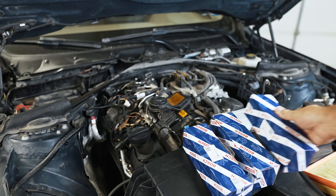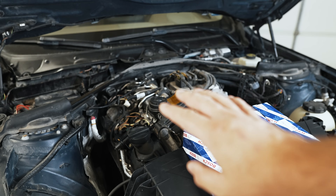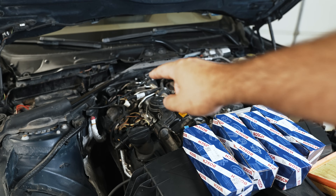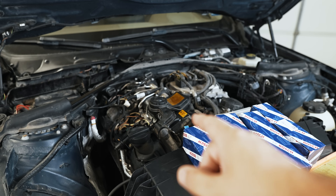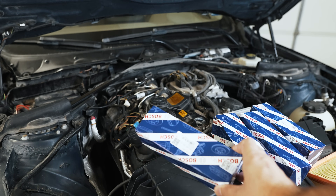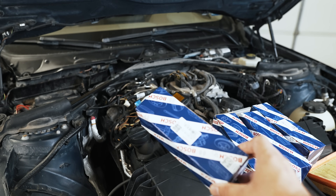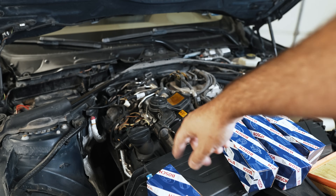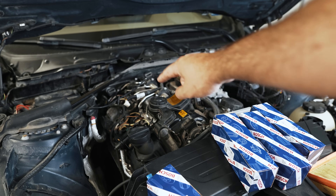I came to a realization and a general recommendation based on the evidence from the car and the computer. I believe these cars are tuned to run very efficiently — they're not like older generation cars where you'd see a black spark plug before detecting a problem. I think it's cylinder number three, but they're all super noisy. From what I understand, either to revise the injector design or with age, they get noisy and clicky. If you're getting a P0172 code, it could be your MAF or air filter, but really 90% of the time it's the injectors. It's just barely out of range — the car doesn't smell rich, there's no black soot out of the tailpipe. On a four-cylinder with only one primary wideband upstream sensor, you can't narrow it down to a specific cylinder the way you could on a six-cylinder.